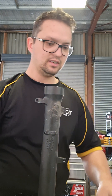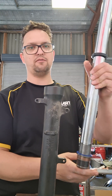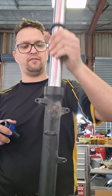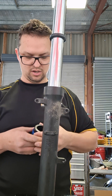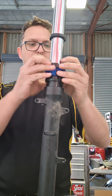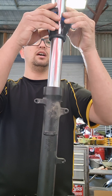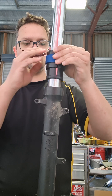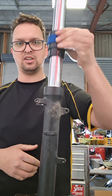That should be enough heat. What I like to do — as you can see I've prepped everything — is fit the bushings first, or seat the bushings first, just to make doubly sure they are properly seated. I'm using a 41mm fork seal driver and seating them carefully.